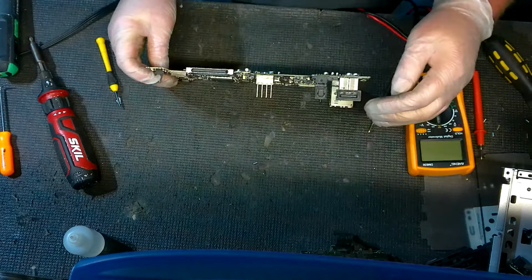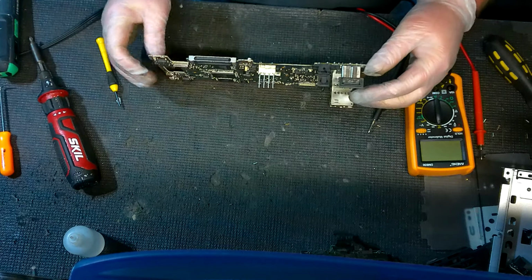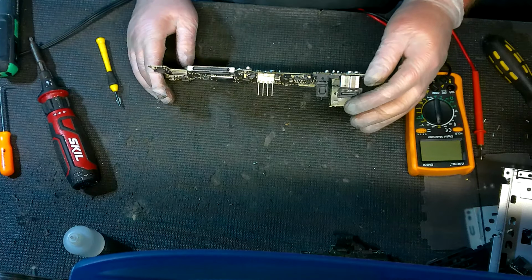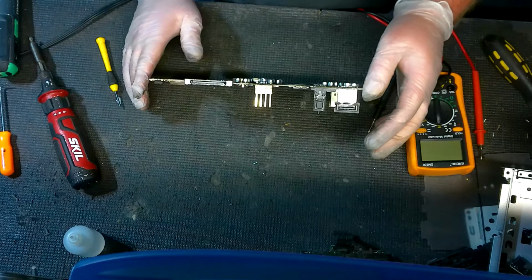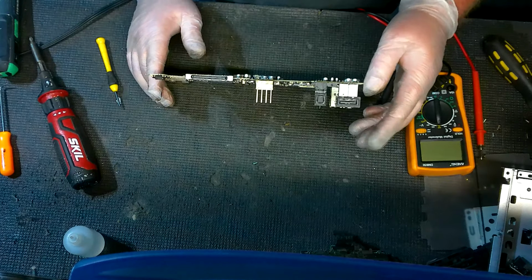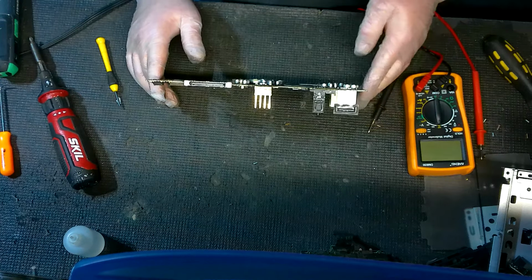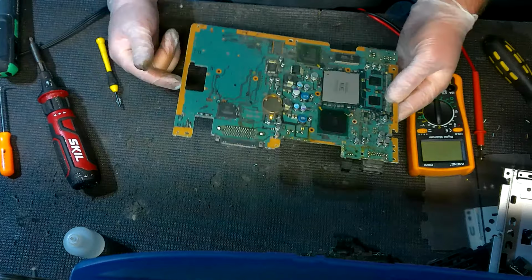Like I said, I think adjusting those clamps inside the AV port is literally going to help at least half of the consoles that I deal with that have no video. Literally, it ends up working out to about half of them are always those clamps in the port. So that'll help more people than you realize. And then, as you saw, I just tore this out myself. It doesn't require soldering or anything.